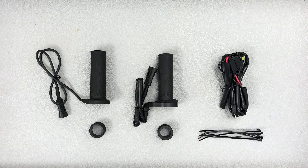I am skipping over the part where I am connecting the cables to the battery. In order to do so and to avoid chafing of the cables, you need to remove three panels per side, two brackets, lift up the tank, and remove the battery. It probably takes about two hours to do so, versus five minutes to connect it just to the auxiliary port up front.